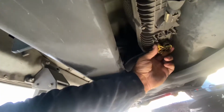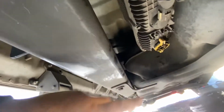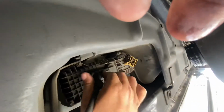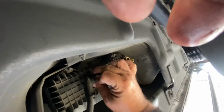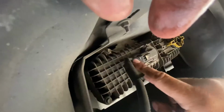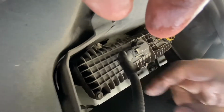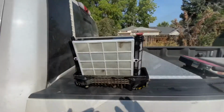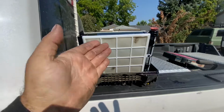Okay, so it has done draining, or is done draining. English is hard. Reclose that, and that's good. Then those 5 bolts that I showed you earlier, and this electrical connector, which is fairly simple when it wants to work. Okay, I'm going to have to get a better angle. Anyway, little plastic release, push it in, slide the connector off, zip off the 5 bolts, and you're good. Anyway, we have got the second filter.